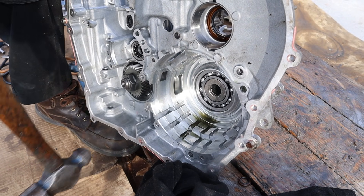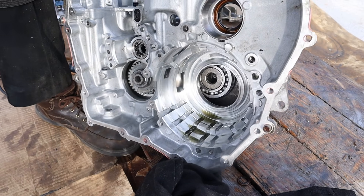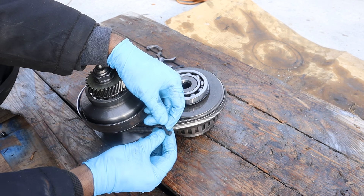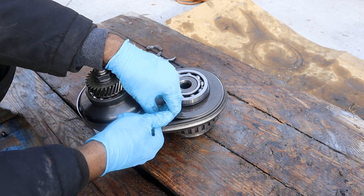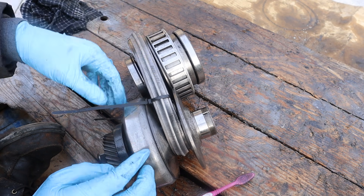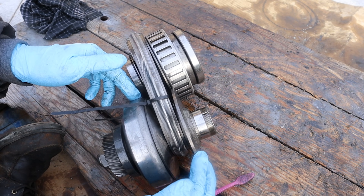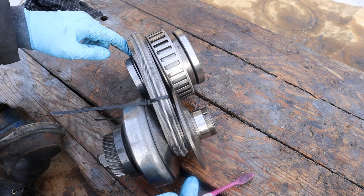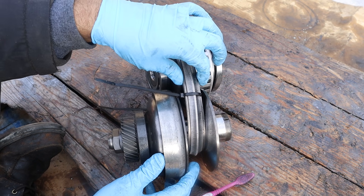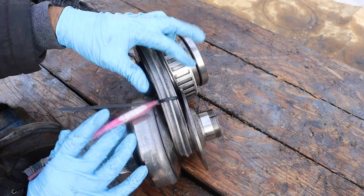The back of the planetary gear set has a bearing pressed into the housing, and that's what's holding the secondary pulley in. I'll give it a little tap and then remove the entire pulley set from the casing. I'm just adding a zip tie to keep this belt as a desk ornament so it doesn't fall apart. Here we have the guts of this CVT — the belt and variators. These are called variators; they're basically giant hydraulic pistons that move in and out relative to the fixed side. The input side is fixed on one side and the variator sides move in and out. Between these two you have a 22 degree angle, and likewise on the CVT belt you've also got a 22 degree angle. Depending on where this belt is on this radius is how you're going to set your drive ratio.